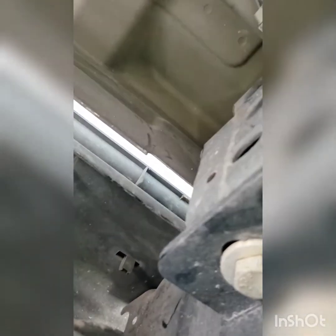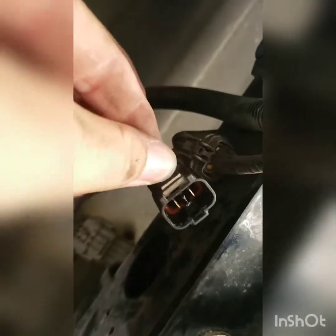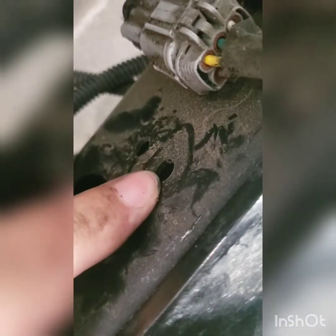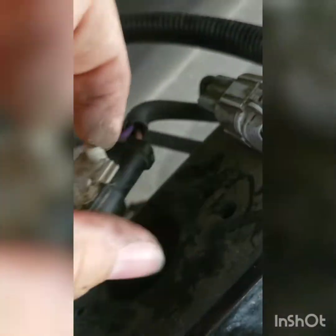We're under the driver's side rear of the Nissan Frontier — mine is a 2013. I used 45-degree needle-nose pliers and put them through the frame rail to pinch the connector on the inside, which goes into that hole there. That keeps it from moving up and down and lines it up with the other side so it's not swiveling.